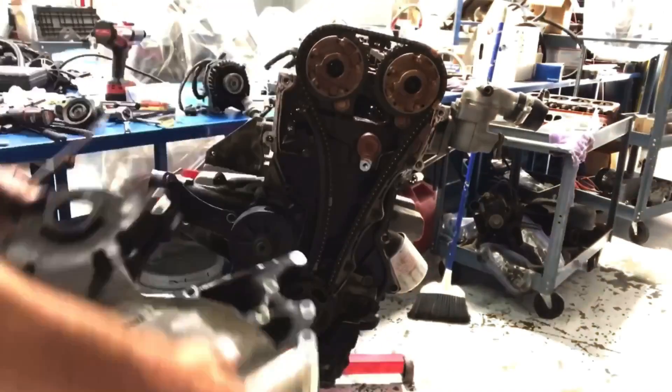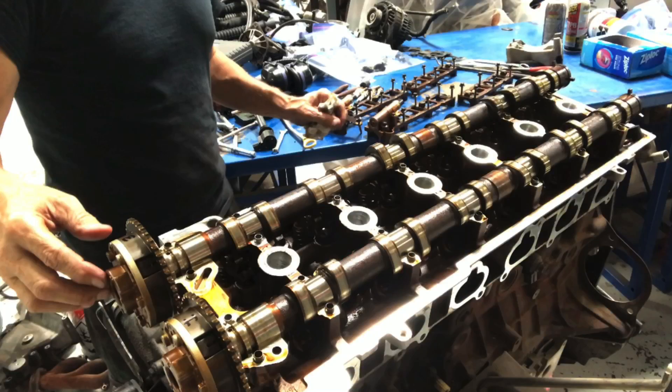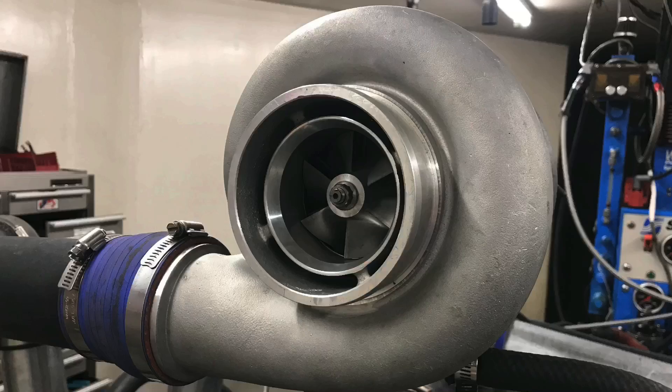What did we learn from taking apart the Barra and flow testing the cylinder head? First thing: I got to take apart a Barra — fingers crossed I know how to put it back together. The cylinder head flows between 250 and 260 CFM, which is enough airflow to support 375 naturally aspirated horsepower — more power than the Barra even makes. What does that tell us? There's room to grow. Put cams in it, a different induction system, more compression — there's plenty of head flow to make more power, which might tell us why they make such good turbo motors. I'm Richard Holder. Make sure to like, share, subscribe, ring the bell, and I will keep airflow and dyno testing.